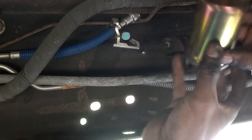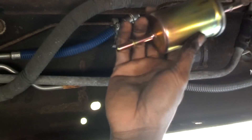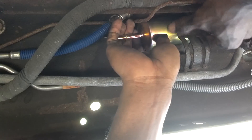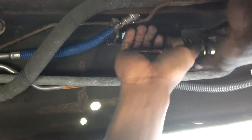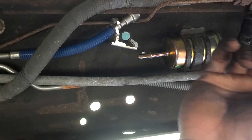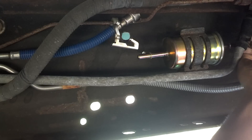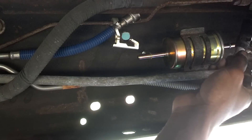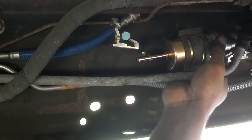Take your replacement filter. Also, you want to check to make sure your hoses and clamps are still looking good. If there's any kind of wear and tear, replace your hoses and clamps. Put the new filter right in. Then all you do is connect the fuel lines back — make sure they're connected all the way snug. You should hear it snap. That one snapped.